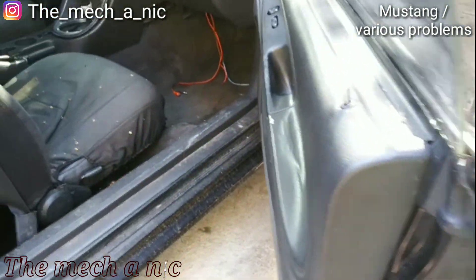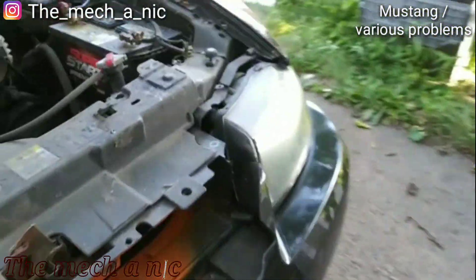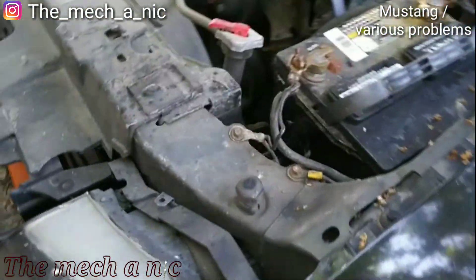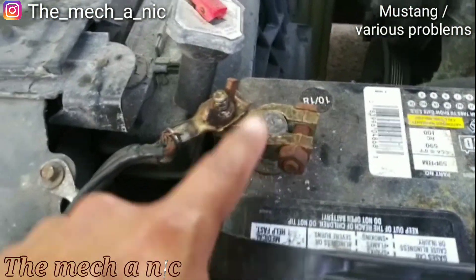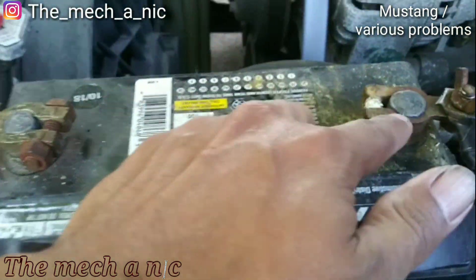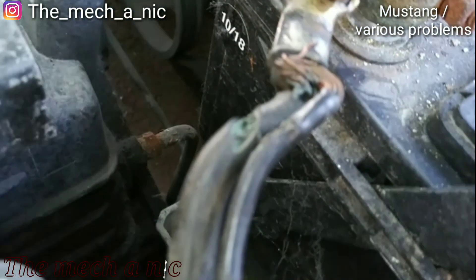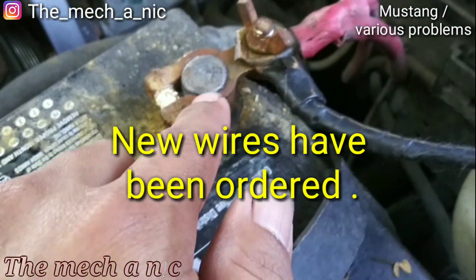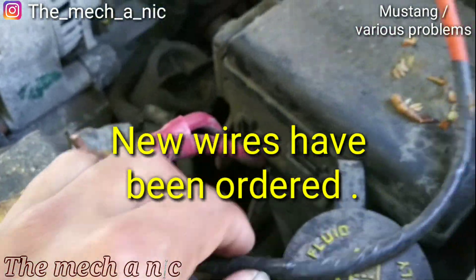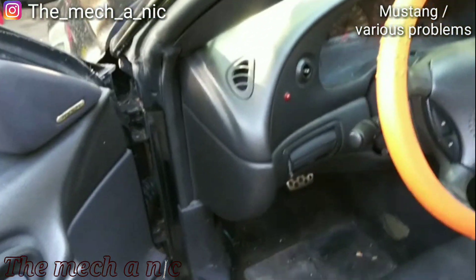That took a while. Then I get into the car, go to start it, and absolutely nothing. I check the battery — these are them cleaned up, okay, they were horrible. It now starts, but look at all these wires — completely corroded. Same thing on the positive side, everything is just nasty. These wires need to get replaced. I've got plenty of time invested in this.